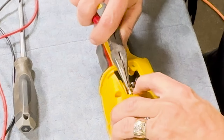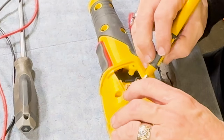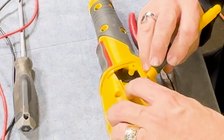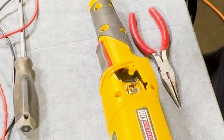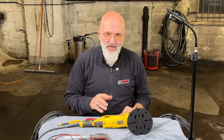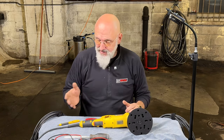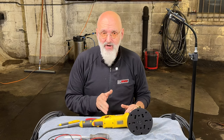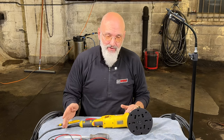Insert it, making sure the channel is free and the wire is in there. Put this back on, and then using your little screwdriver once again, lift up on the spring, move it into the slot of the brush, and that's all you need to do. Put the cover back on and you're good. We include a set of replacement brushes. If your machine is intermittent — you hold it a certain way it stops, another way it doesn't — it's either the cord or the brushes. The brushes are an easy thing to check, and if it's not the brushes, move back to the cord.